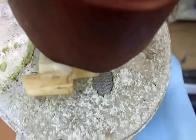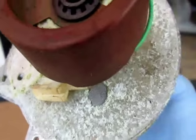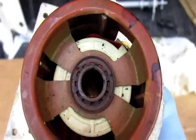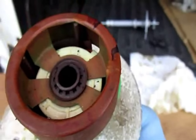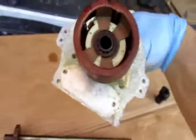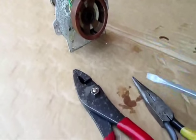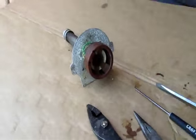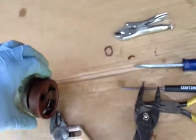Now you have this little clip that you pop out - try to be careful and save it if you can. Our pickup coil is not looking too hot either - I might change that. I see it coming apart but we need to get this little clip out. See how that is with the little ridge edge - that's how it goes on, don't put it upside down. There are two different ways you can put that clip on and the teeth go up. Note the position of the copper piece because we marked that with the distributor rotor. To get this clip off it's tricky - use a combination of pliers, screwdrivers, and a little pick tool, just keep working it.